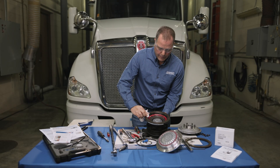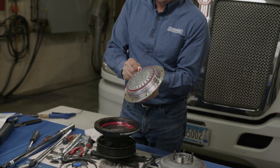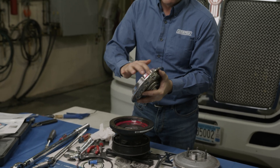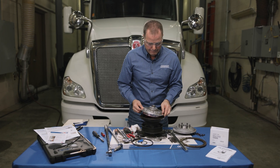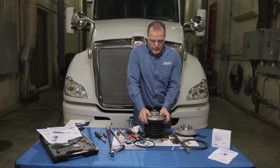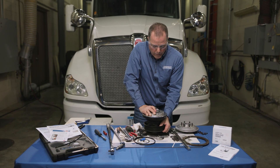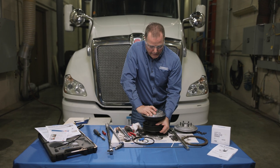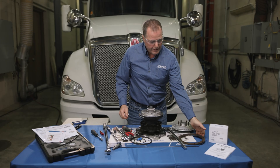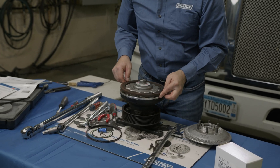Take a rag and wipe the top of the area where the friction material goes. Now install the clutch pack back onto the clutch — add a little grease on the outside where the quad seal will make contact. When installing, hold it at a slight angle, push down, and you'll feel it seat into the quad seal. Turn the clutch pack 180 degrees to ensure the quad seal is fully seated and won't leak, aligning the holes for the liner screws as you complete the rotation.